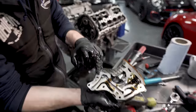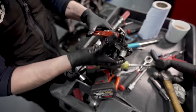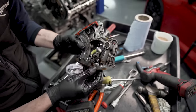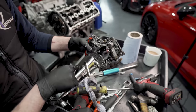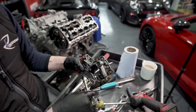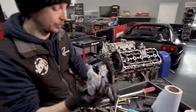So you've got a little gauze to protect it, so the oil comes in through that port and goes to both sides. And you've got the plastic runners. And that's it, and then oil pressure comes in the back, pushes on that plunger, which pushes this out. So we always know the chain's going in that direction. Yep. The chain's being pulled on this side, because you'll never have a tensioner on the pull side. So it's always on the free side. So you can look at a tensioner and know which direction of rotation the engine is.